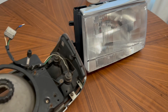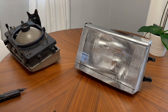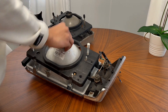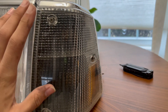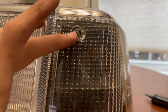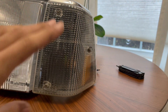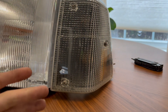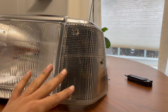The last thing I want to mention is that if you need to replace either the turn signal or parking light bulbs, it's very simple. There is a screw on your side marker here, here, and right there. Remove those three Phillips head screws, pop off your lens — there's a rubber gasket which just pops right off, and you can probably reuse it if it's not corroded. Your bulbs are literally gonna pop in and pop out, same for the top and bottom.